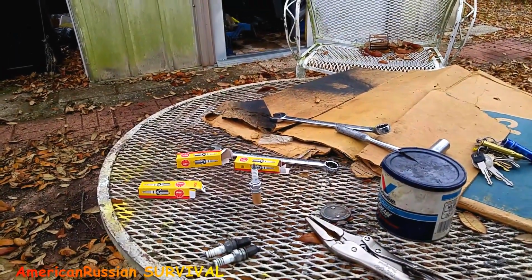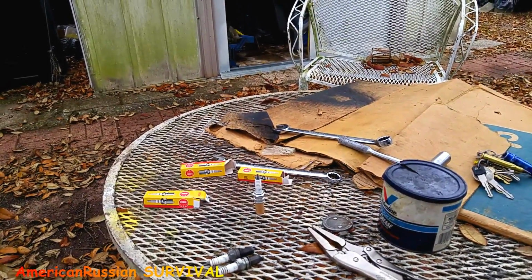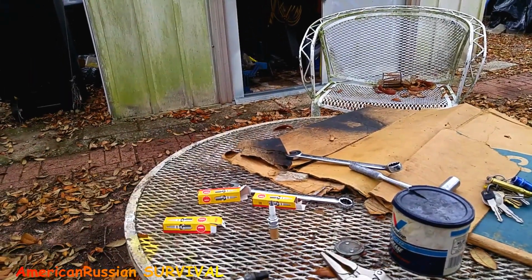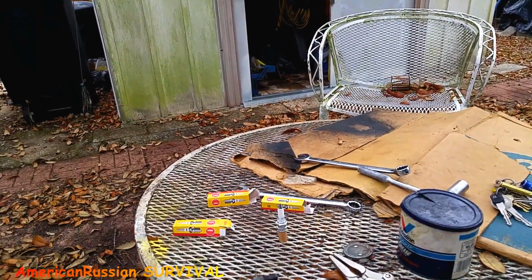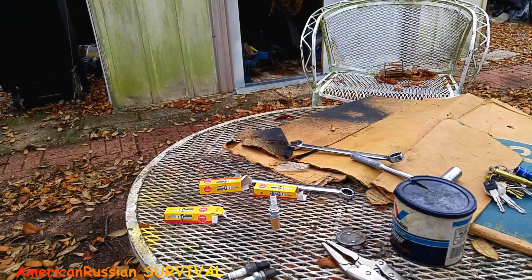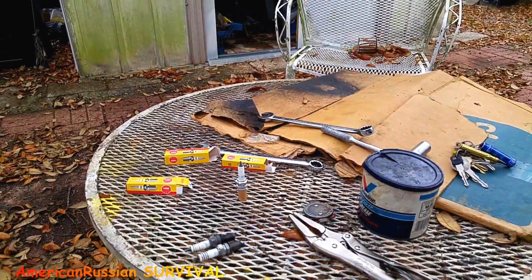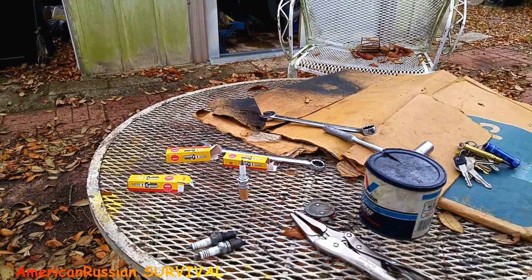As soon as I put them in, I was thinking, I don't know if this is going to work, because usually if the plugs are fouled, starting fluid will make it light, it'll just boom. But you could see I have those little red things on there, I don't know what you call those. I don't have them there for looks. I have them there to make sure I've got spark to my spark plugs. If something goes wrong and I can't start it, I want to at least know I've got spark going to the plugs. So either the spark plugs are bad, or there's a fuel problem, right? Unless it's a weak spark. That's why I like that thing.